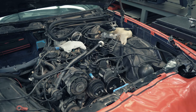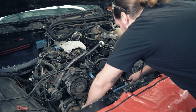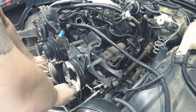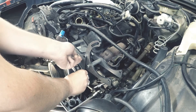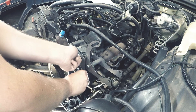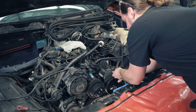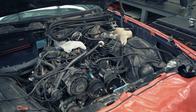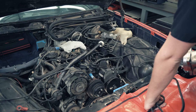This is a good time to install your power steering belt, or measure that belt setup if you're using a different pulley system. I'm going to install the power steering belt — it goes straight onto the crank. Depending on the length of belt you're running, it may be useful to remove this bolt real quick so you get a little more play, then slide it back up in. We're going to leave that loose because we'll tension it in a minute. Next, we're going to install the compressor onto the bracket setup, and we'll use this opportunity to install and check our belt length.